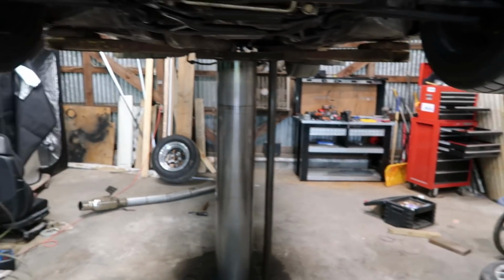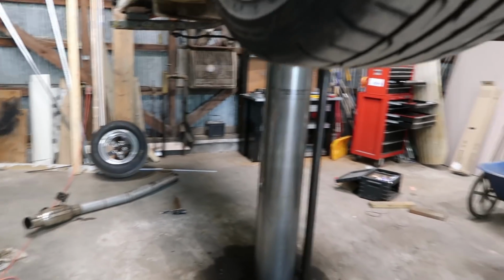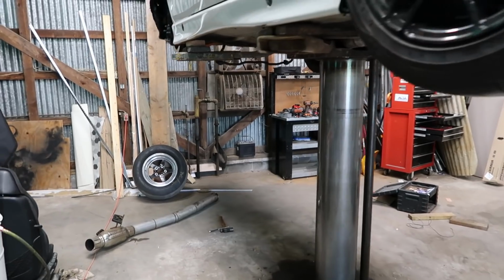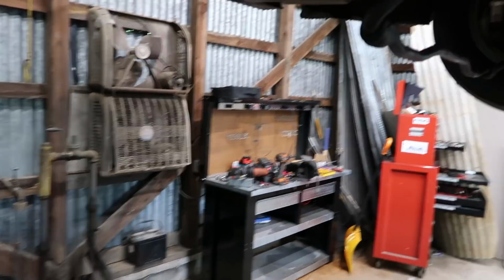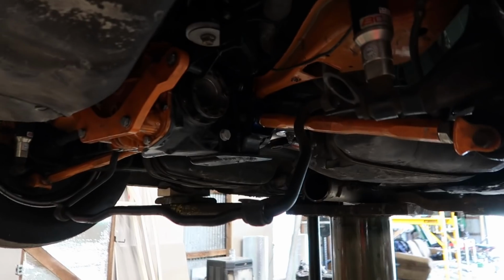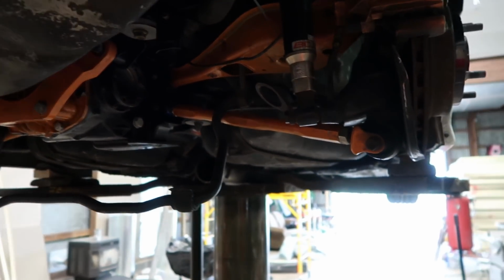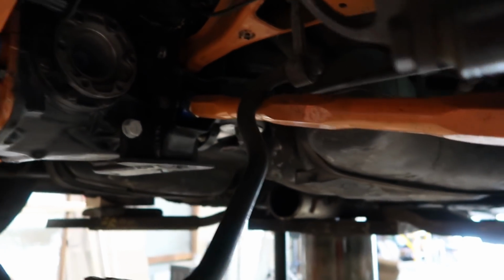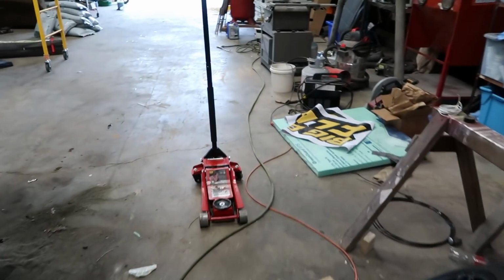So I have that set up, and then I went for a cruise, basically just down the street. I noticed it felt really, really funny. If I tried to roll into it a little bit, the car would kick out almost, like it had a broken axle. So I went back and jacked the car up, and one wheel was spinning and one wheel was not. I looked at it, and the actual shaft was not spinning, but the actual CV was spinning. So obviously that's not correct.